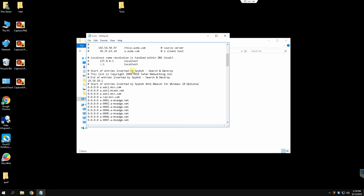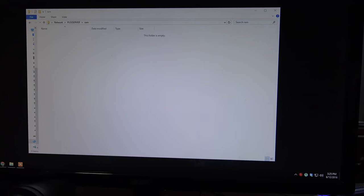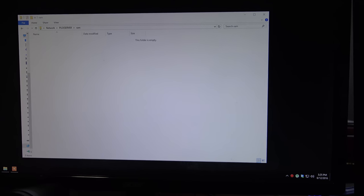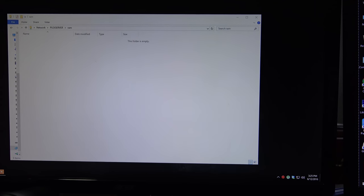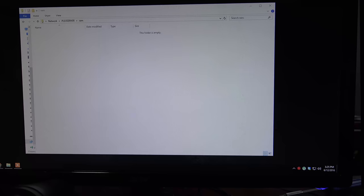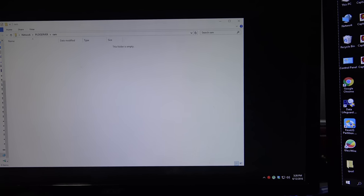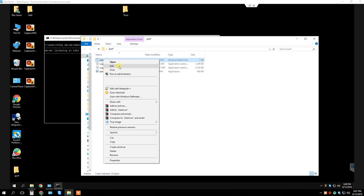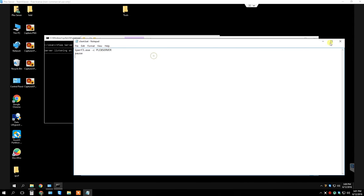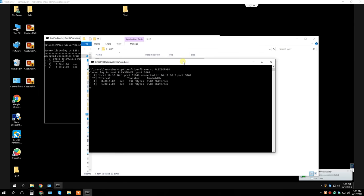And that would, when I do a file dump, pretty much hinder the usage of the Plex media server completely, even on the lowest settings, just because it maxes it out and makes it unbearable. So now, once I got it installed, I did do some buffer configurations, which I'm going to go through and play with some more, and make sure they are optimal settings, maybe change a few things, do some more tests. I did run an iPerf test on both PCs, and it was coming out to, I think, like 8 or 9 gigabits a second, so it was definitely good speeds from that, so I might not even mess with that, honestly.